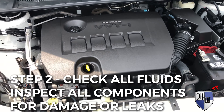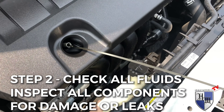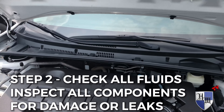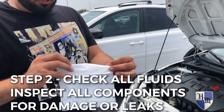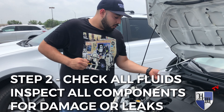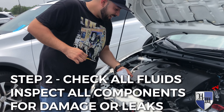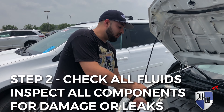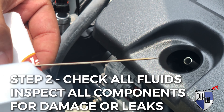Whoever had it before took care of it. It's a 2016, so it should be good. First things first, you've got the oil dipstick — look at the condition of the oil. This oil actually looks really clean. Get a rag or a piece of paper so you can check the dipstick. Clear it out, make sure it's clean, put it back in, and make sure it's within specs. So far that looks like pretty good oil — it's in great condition.